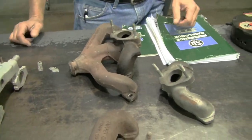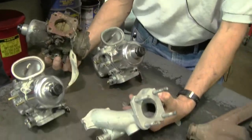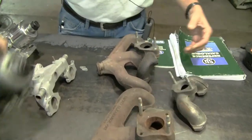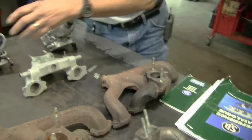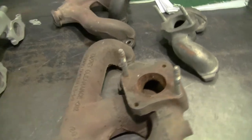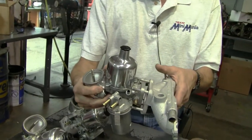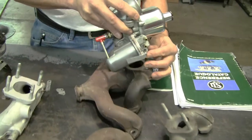Some of these carburetors have been converted, so you'll find an HIF 44 on a four-bolt flange manifold, sometimes on a two-bolt flange manifold, or even a one-piece manifold — all will still fit. You can put either a 44 or a 38 on any of those. Likewise, you can put an HS-4 inch-and-a-half carburetor on a four-studded 44 or 38 manifold, on a two-bolt, or a diagonal two-bolt manifold.